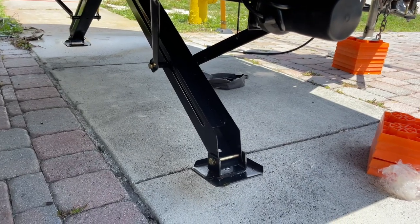Good morning — we're heading to Kelly Park in just five hours, so let's finish up these stabilizer jacks. The front went in with no problem; everything lined up perfectly on the main frame of the RV. That really makes me believe the back issue was just that whoever put on the bumper mounted that one rail a little bit to the side — it was supposed to be centered on the I-beam. All we have to do now is put in the front switch and finish everything up. The entire front installation took about 30 minutes.